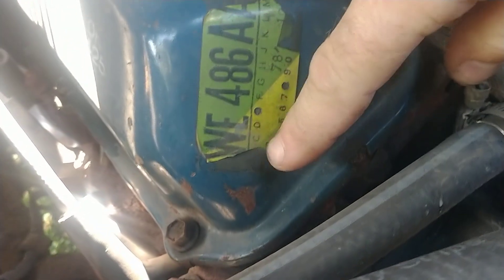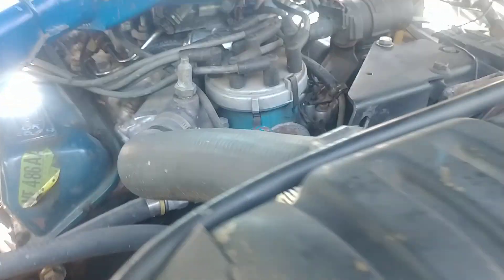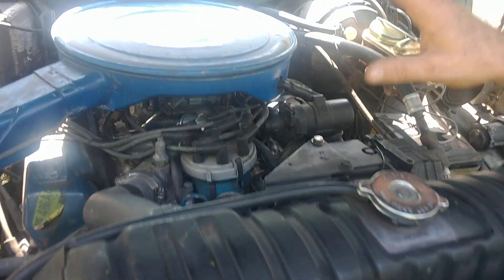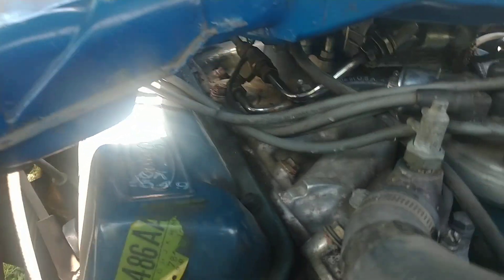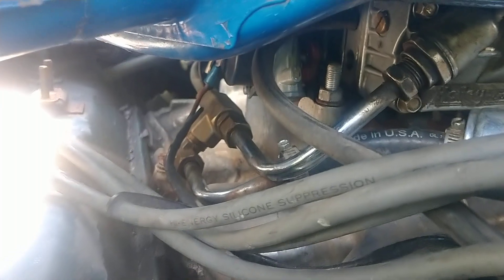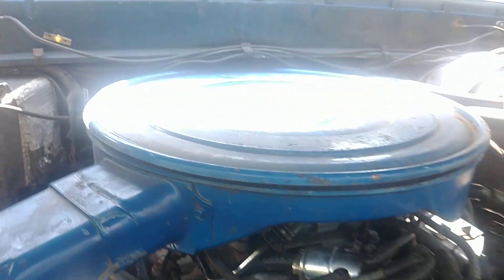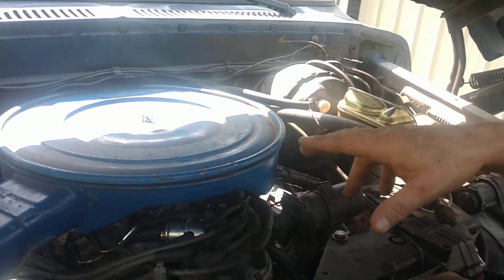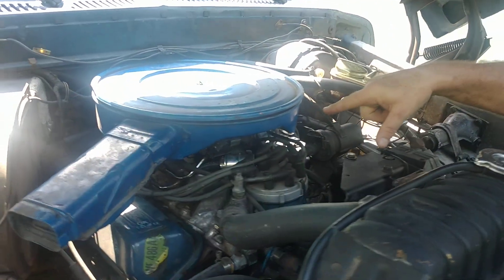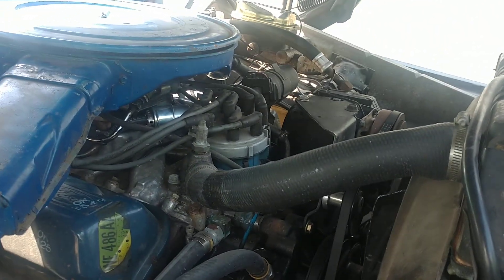Here are the original stickers on it from 1978 — that's the coating they used. It had a cast iron manifold on it with a Motorcraft 4-barrel, but we had to get rid of that. It's got a Performer 460 on it now with a Holley 770. It has a set of rod main bearings rolled in it, a freeze plug was replaced, and we advanced the camshaft 4 degrees, which livened it up quite a bit.